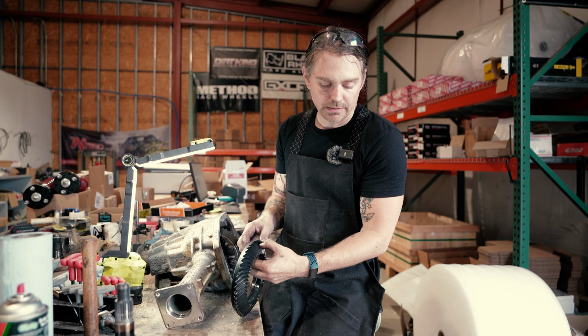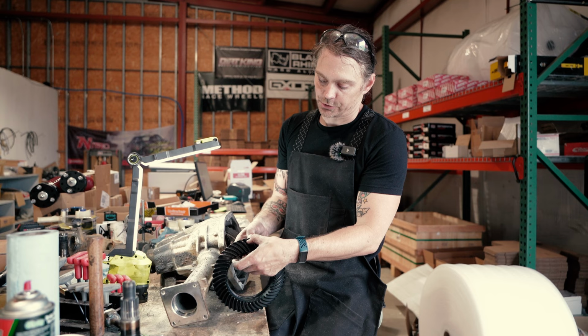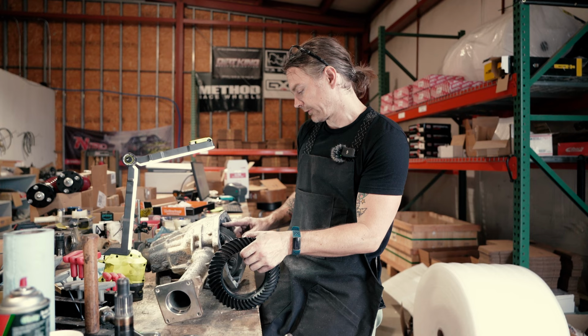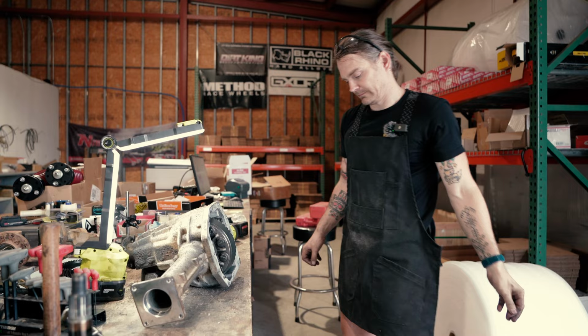It's actually really shocking if you look at some of these other manufacturers out there like Nitro or Yukon or whatnot, and what they've done to net that clearance. So where other companies are actually shrinking the diameter of the ring gear in order to create clearance, what we're trying to do is give ourselves a little bit of a bevel while still keeping your full ring gear diameter and width. So hopefully we'll get this dialed in and then ADO gears will be the best and strongest on the market.